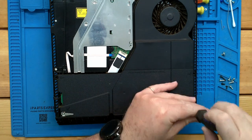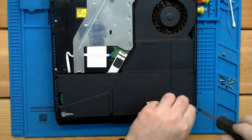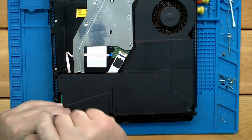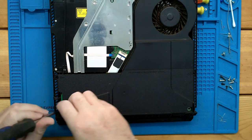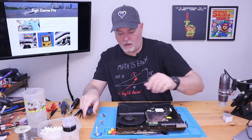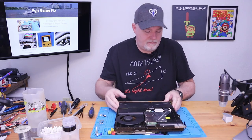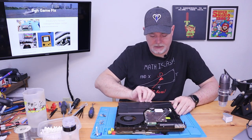And you have two Phillips screws and these are kind of long. And depending which board this is, I haven't even really looked. When you remove these, you have to be a little bit careful, these long screws, because there is a capture nut on the board. We'll see it when we flip it back over. Just be aware that if you have a board like that, it's gonna fall out. All right, so now our screws are out. There's two main contacts on this side, so it usually needs a little pressure to get it up and out from this side.